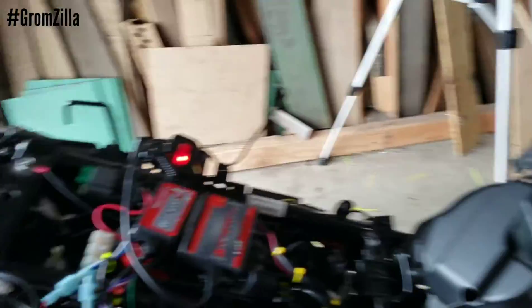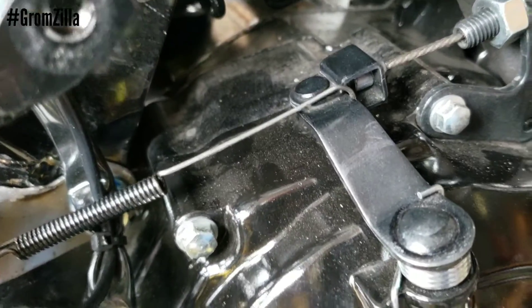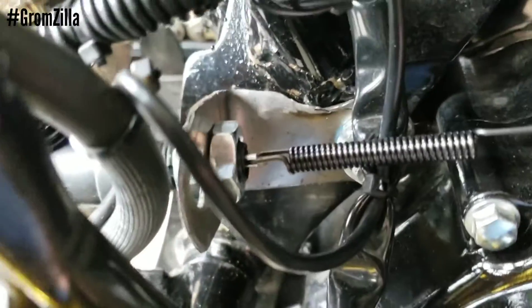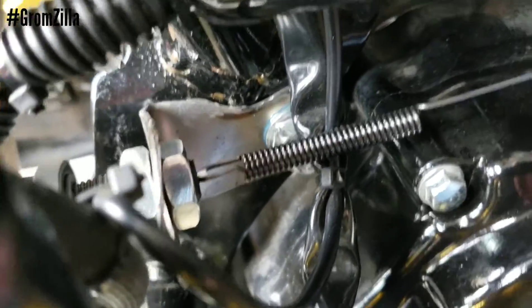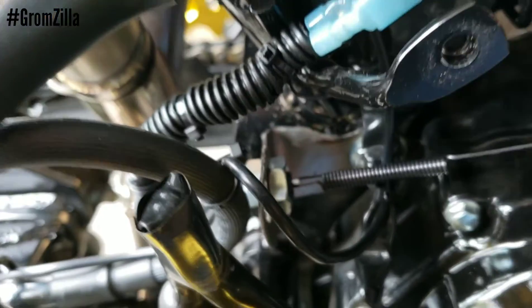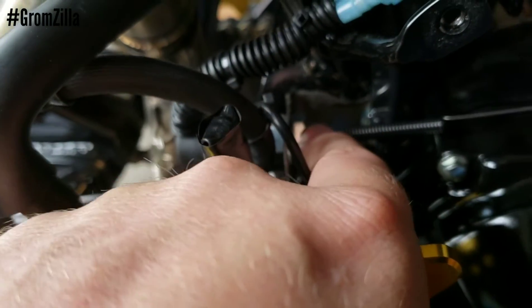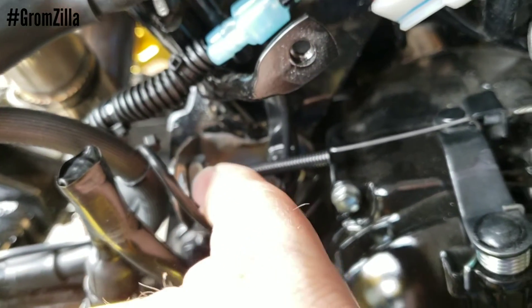The way I have done it — this is your clutch lever right here, or what your uses pulls your plunger for your clutch. So you can see this black spring going down here. I have made a bracket; obviously it's not finished yet, we're going to paint it, but we're just testing it out to make sure it works. This is a spring-pulled brake switch — that's what you'd most commonly find this type of switch on. So when this is pulled, it pulls the switch and turns it on. This switch is normally an open circuit, so pulling it closes the circuit. We use the engine bolt mount right there, so all we did was basically make a little L-bracket.